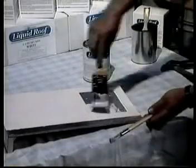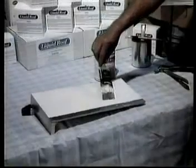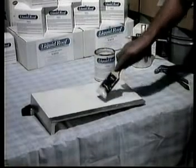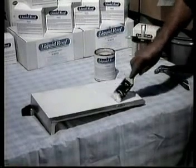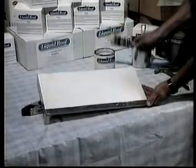Finish your repair, covering the edges and rivets with liquid roof. Because the rubber will drain into the stem of the rivet or may be pulled under the plate, keep checking and applying more liquid roof as needed for at least the first hour.